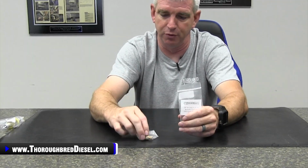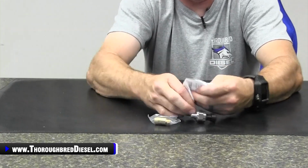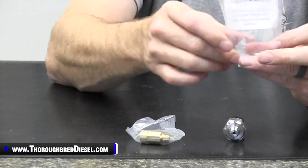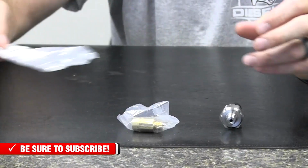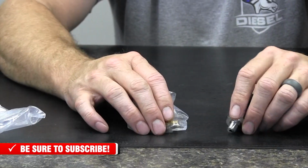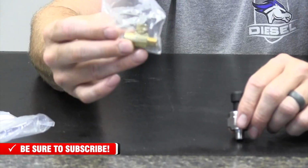Now I want to talk about the fuel pressure sensor kit just a little bit from Quadzilla and show you what you get in the kit. Another nice thing about this kit is they include a snubber with the fuel pressure sensor kit, which is taking it just a step farther. We know that with the way a Dodge lift pump system goes, once the lift pump fires up, the pressure spike to the fuel pressure sensor can cause damage to it, so you have to run a snubber.